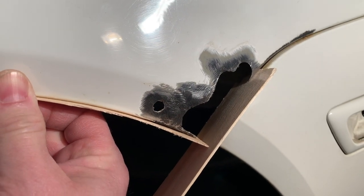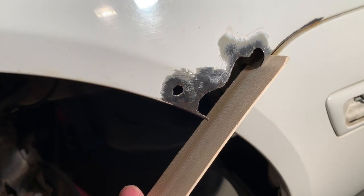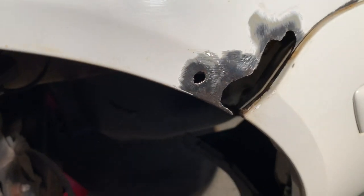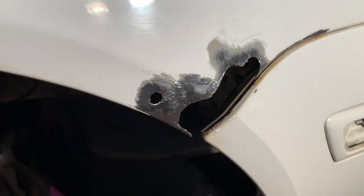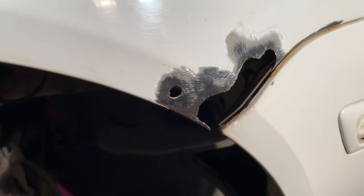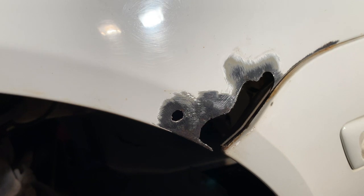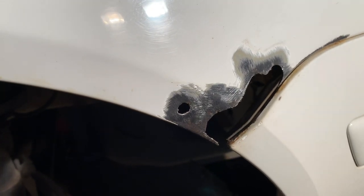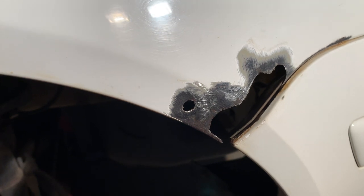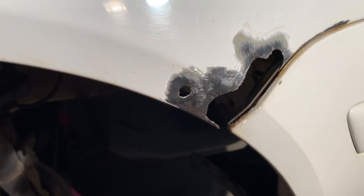And then I will use some fiberglass cloth, some resin that will be thickened with some chop strand fibers. That way it'll have some additional grip, and basically just going to let this cure up for 24 hours, and then we'll come back and sand it, and then we'll put some either putty or fiberglass reinforced resin just to start to get the shape.